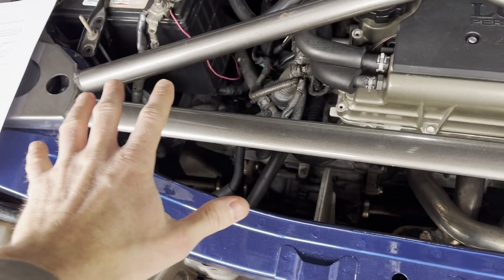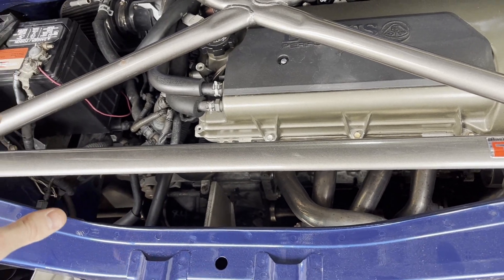In the MR2 update video I was talking about how I wanted to fab up a custom exhaust — I was just running a cheap eBay header and the rest of the exhaust was thrown together quickly. This seems like the perfect opportunity. The current plan is to fab up my own header that will shoot up and over to get the heat as far away from the supercharger as possible. It'll create a bunch of clearance between the header and the supercharger, and if I'm still worried about heat at that point I can still make a heat shield to go in between for peace of mind. It'll just be a fun project to weld up and hopefully serve a purpose on the heat management side of things.